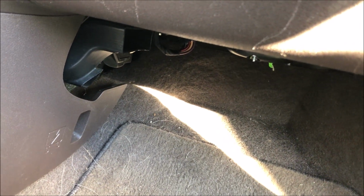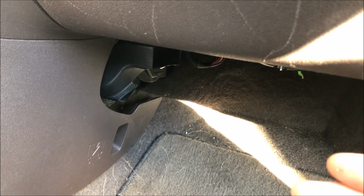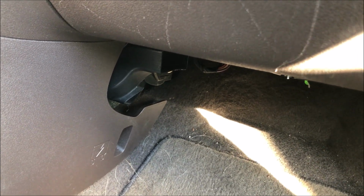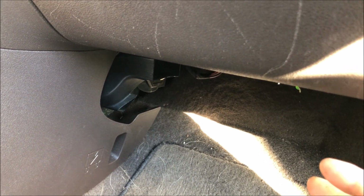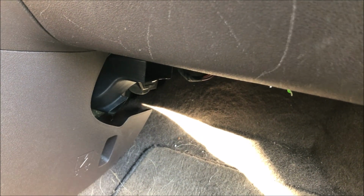Did some testing, and from the sounds of it, there's always supposed to be constant power going to the blower motor, but the resistor controls the ground side. It's not supposed to be grounded with the key pulled out. This would literally run with the key out of the car, doors locked, everything. So we're condemning that resistor as shorted out, so we're going to be replacing that today.